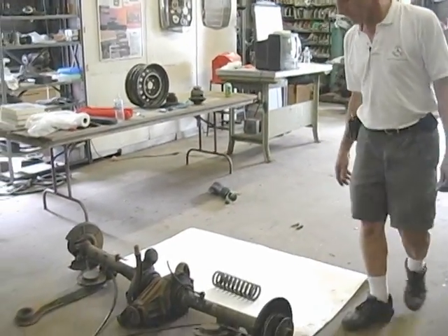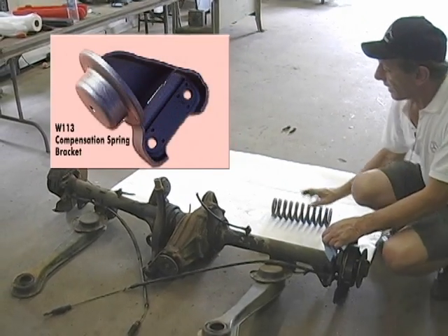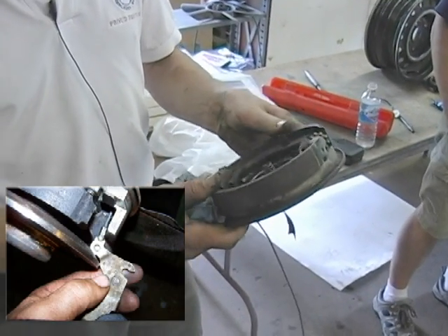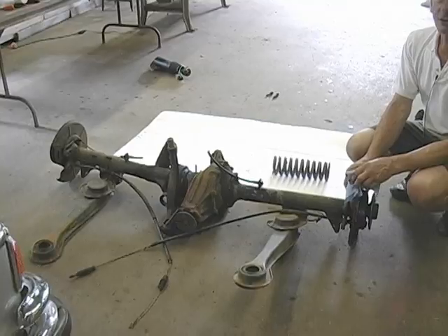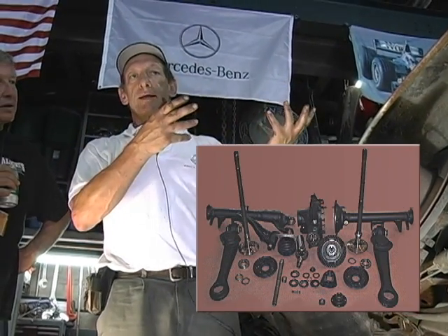This is your 113 rear axle. The parts you need to save off of this are your emergency brake cables on both sides, your rear crossover spring, the bracket that holds the spring in place, and all the rubber parts. There are some springs and pivots and different things you have to unhook to get this off before you can unhook the emergency brake unit. Essentially everything else is a direct changeover. Normally before you put one of these axles in the car, you tear it down and put the rubber bushings in.